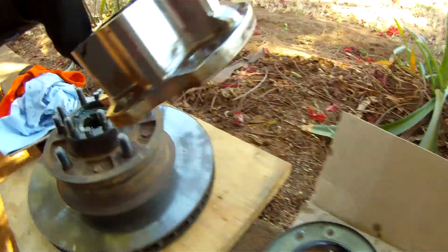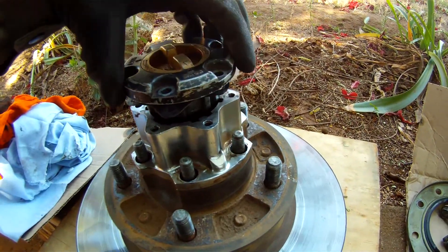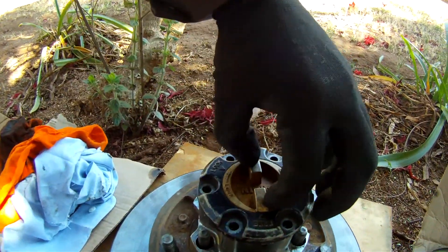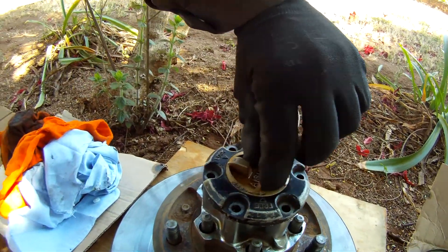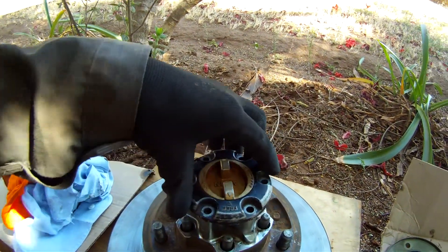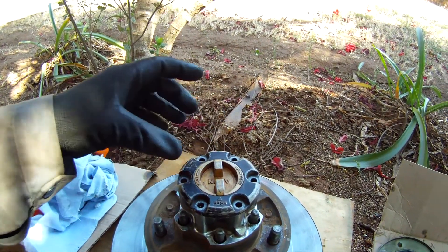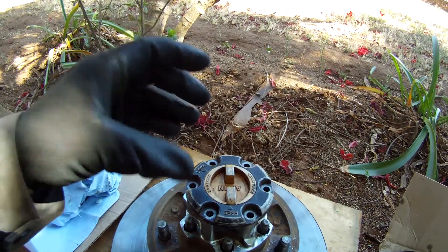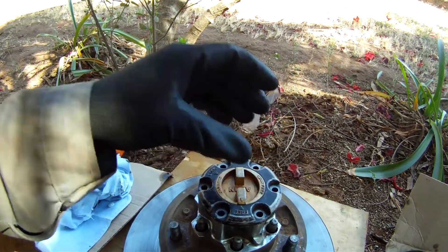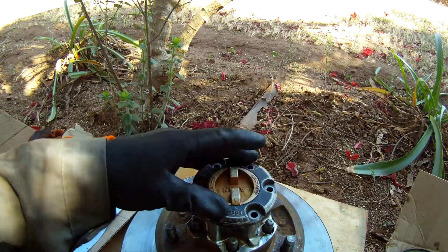I'll just show you how it fits on like that, and then the freewheeling hub goes in alignment there and you lock the freewheeling hubs like that and unlock like that. I don't really like freewheeling hubs — I prefer permanent four-wheel drive — because this requires you to get in and out of the cab and there's a lot that can go wrong by leaving the vehicle in four-wheel drive when you leave an off-road situation. If you're not in the cab it's not as easy to do, so you're less likely to remember to do it, which could cause a lot of problems.